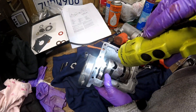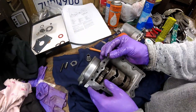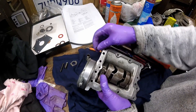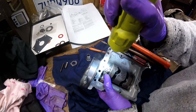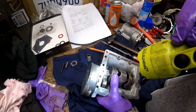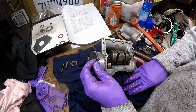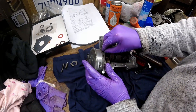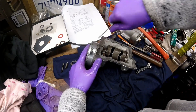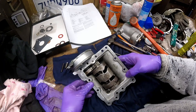You want to make sure you have your alignment groove in the center of that hole — it takes a retaining pin and I'll show you that. This is the retaining screw that goes down in here, retaining that shaft in that single groove. You just want to make sure it lines up — get yourself a flashlight. It looks like it has to go in a little further before it's centered. Now it's centered up in there. I'm going to put a little touch of Loctite on this — not much, just a small dab. I'll take this in and make sure it goes below the surface. If it's sticking up above the surface, it won't let your top go onto the transmission all the way.